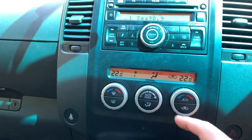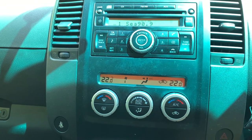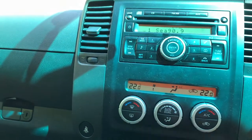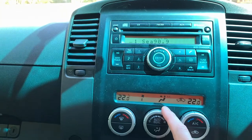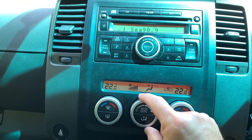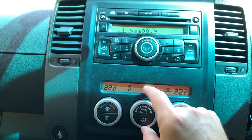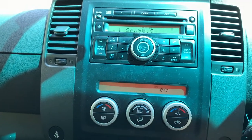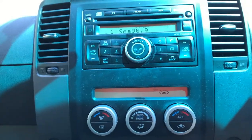I'm now in the vehicle and as you can see, my AC is on. You can clearly hear it within the vehicle. It's showing one bar at the minute, which is obviously not true because it wouldn't be this loud inside the vehicle. If I turn the dial, it doesn't get any quicker. If I turn it the other way to turn it off, it still keeps going. There's still air coming out of the vents inside the vehicle, so it's still not switching off.